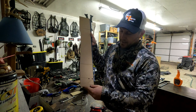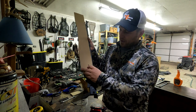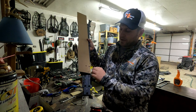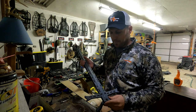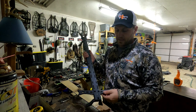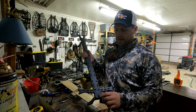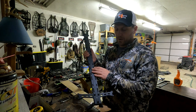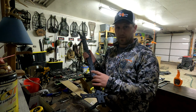You make that jig and then after you're done measuring where we're going to put the holes, you line everything up and mark it. Since I already have my jig made up, I'm going to use it as a reference step when I'm completed. I'm going to take this bracket off, then measure 22 and three-quarters inches, put the jig on, mark it, and drill it.